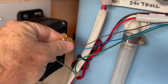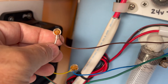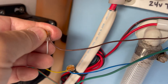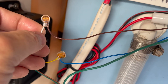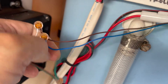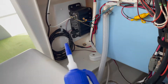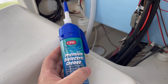What I used to connect these is some Scotch locks I got off Amazon. These were a little bit small, so I had to trim down the wires to get them in. I filled these up with dielectric grease since they didn't come pre-filled, then stuck the wires in and crushed the tops. If I had to do it over again, get the red ones, not the orange ones — the red ones are a little bit bigger for a bigger diameter wire, which is what I needed. Get the red ones, and the 3M ones do come already pre-filled with some dielectric grease. This is what I used as far as dielectric grease — I squirted that into the ends and stuck the wire ends in there and crushed the little cap.